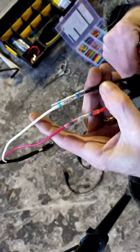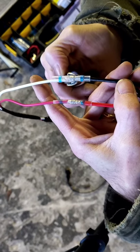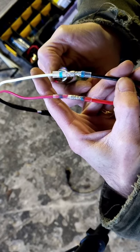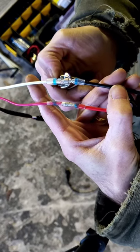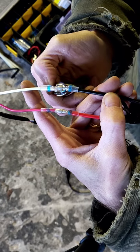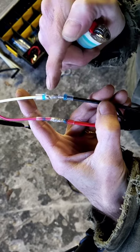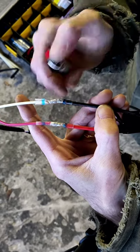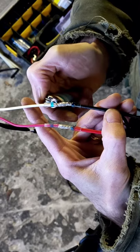Support it on both ends and start heating her up. If you watch the wires, you'll see them start turning silver as the solder flows into them — and there it goes. See that solder running good right over here? That's enough for that side. I can see it better than you guys can on film — the bottom side is sealed up good, she's already run.